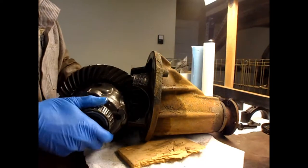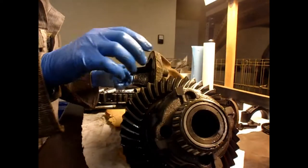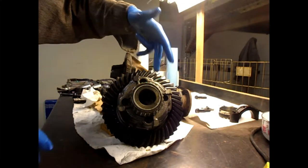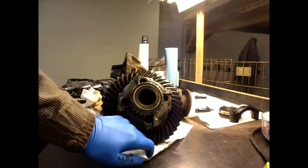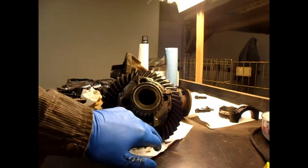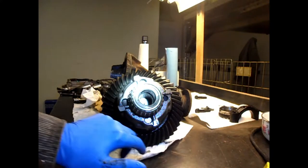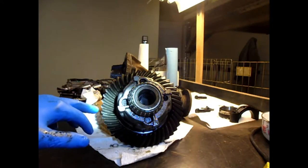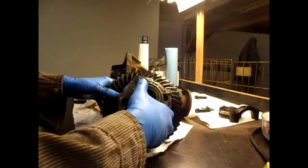For my job I'm replacing this whole piece including the ring gear and the pinion gear — this is going to be the TrueTrac with new bearings, new everything — because this tooth right here got cut off or broken off. I don't know where the metal parts went; I couldn't find the piece anywhere. The backlash is all good and everything looks good otherwise. This is an LSD rear end, a G285, with clutch packs in both sides. They were kind of weak so I decided to go with the Eaton TrueTrac instead.